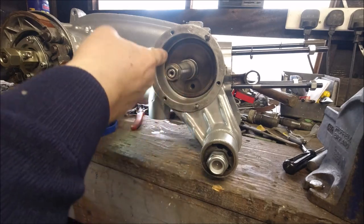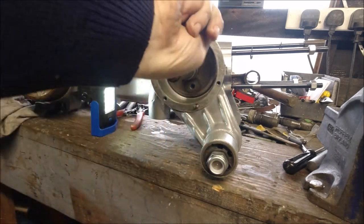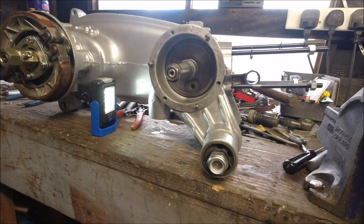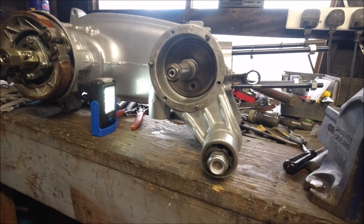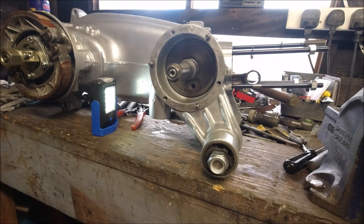What I also like to do is just put a rim of grease in here to aid fitting on the side of the mag flange, because it should be a really good snug fit. That's perfect. Then I'm going to get the gasket out of the box of gaskets and put some sealer on this side - the gasket and the other side. As you build engines you get to know where they leak from, and that's a prime candidate. I'm using Loctite again - MS5522, which is flange plate sealant.